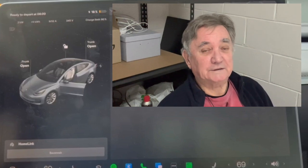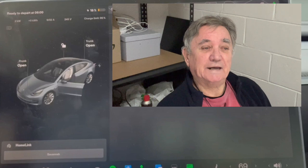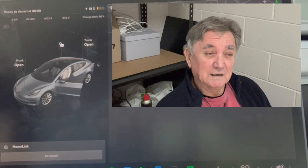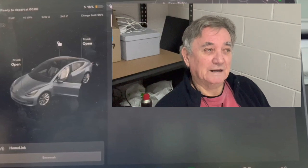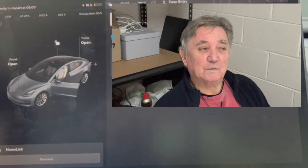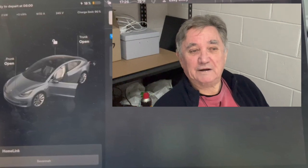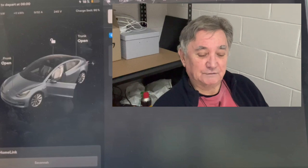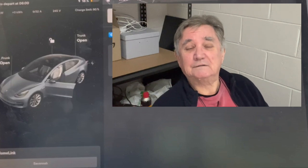I've been told that Tesla does it — you just have a state of health display on Tesla. But what you actually have to do is empty the battery, fill it up, and measure how much went in. I've downloaded a YouTube video showing how to do a Tesla state of health test — I'll put the link below. Once you've seen that, we'll look at how we're going to do it on our ATTO 3, which will make more sense.